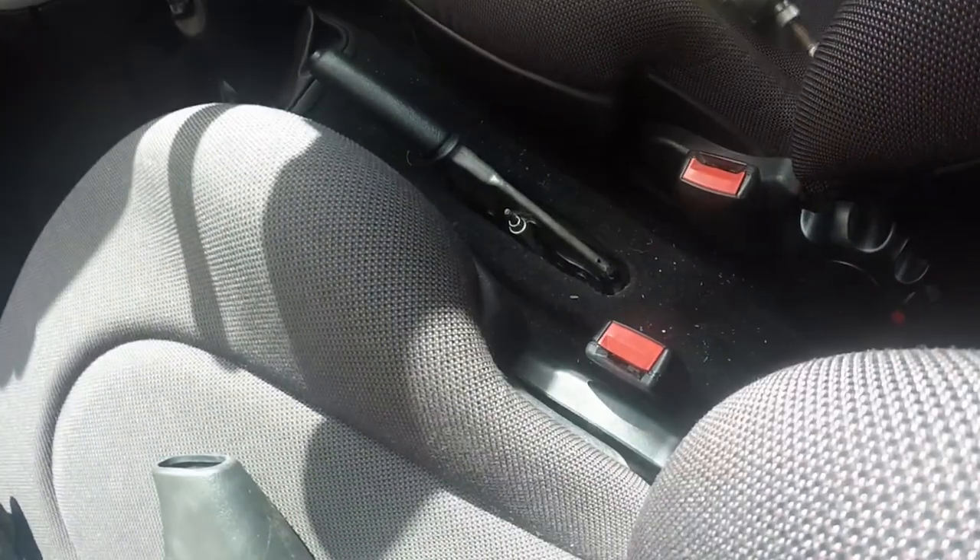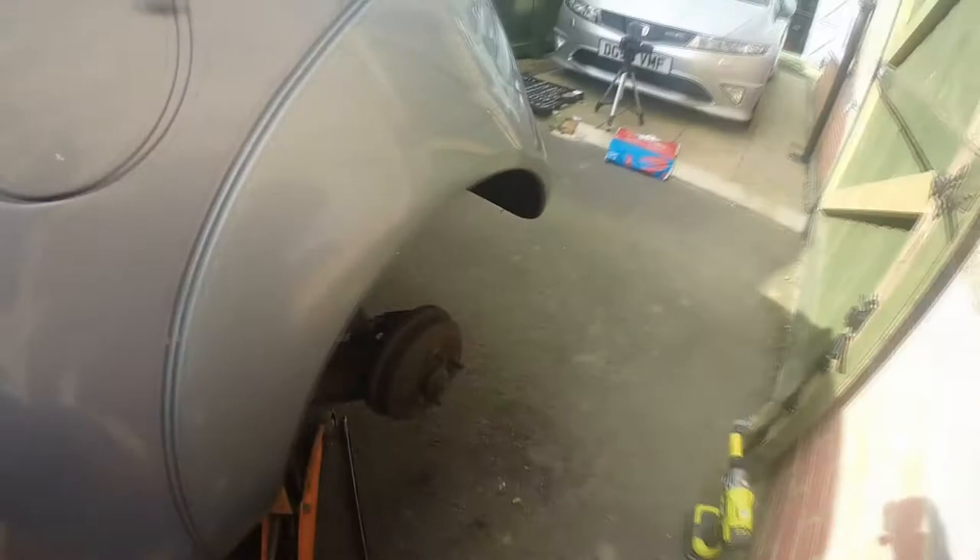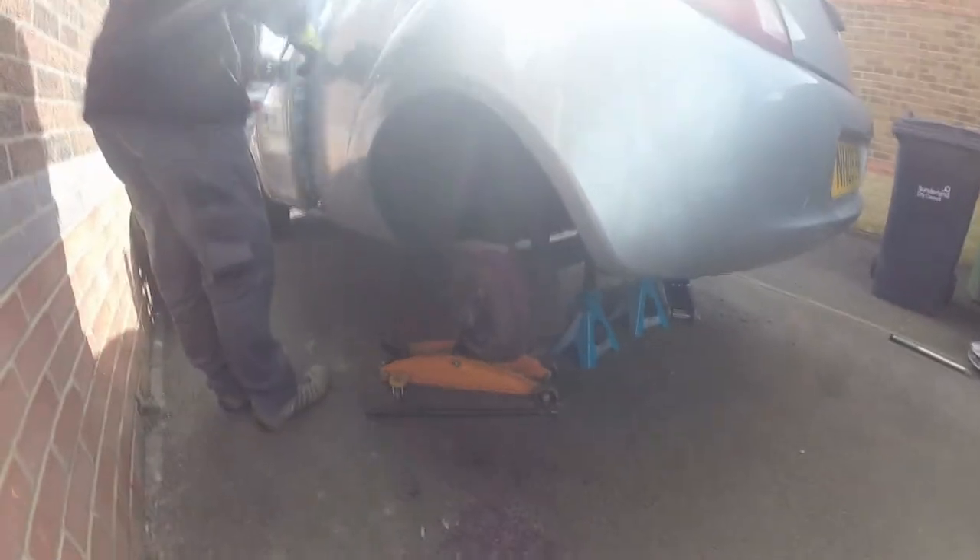I'll make sure we're not binding. We'll do the adjustment but we're not binding. Can we pull the handbrake on? Three clicks - pretty solid. That's three clicks. Also, the handbrake cable will need readjusting at some point after about a week because of the stretch and stuff. Should be alright for now though.